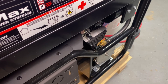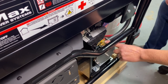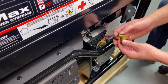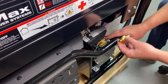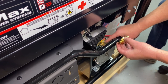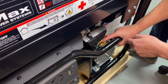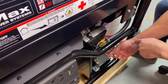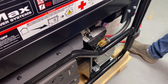I wanted to go back and stress this: this is your main adjustment and your only adjustment. We'll preset it — it's just a jam nut — and what you're doing is closing off the fuel load coming into the carburetor adapter. Turning it in would be lean, and out would be rich, adding more fuel. We'll set this as close as we can since we've had the machine here, but you'll have to adjust it just a little bit. This button here is your primer button — to get the fuel through the system quicker, just hold it one or two seconds, then let off. That'll shoot some fuel in there and give you a quicker start.